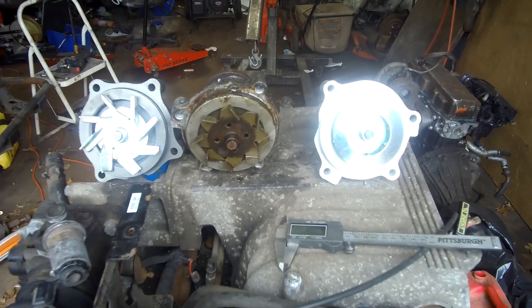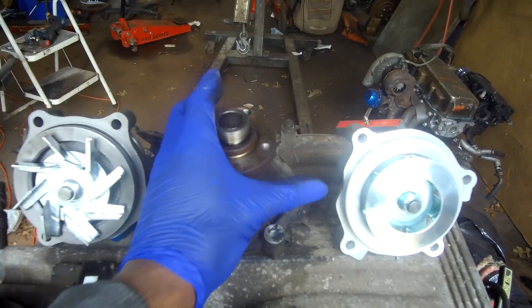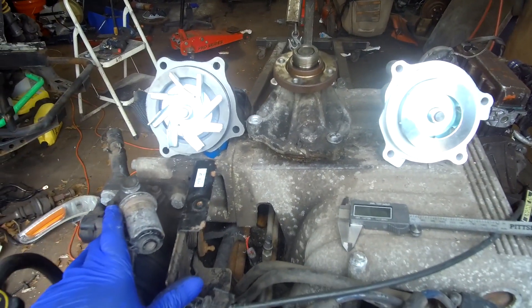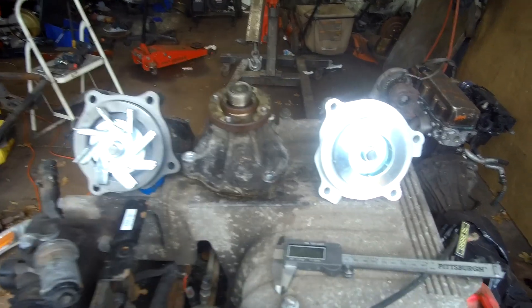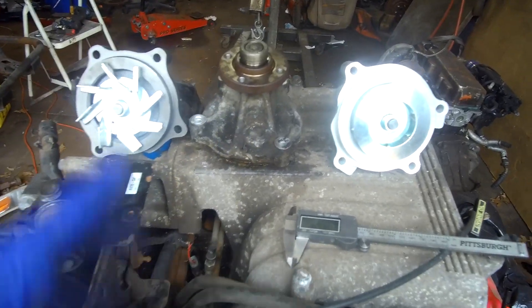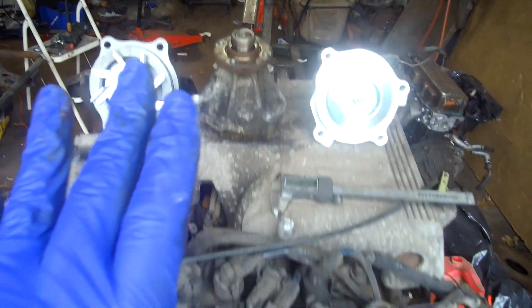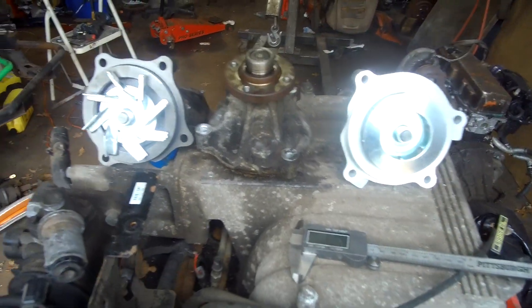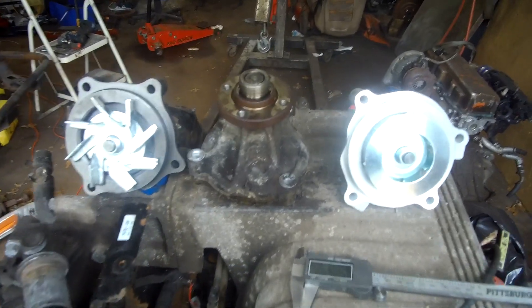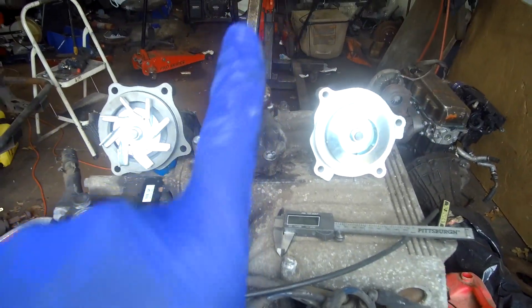I was thinking about getting rid of the fan situation on my car and running a regular electric fan to add a few ponies. But behind the scenes, if you're running the car really hard, a mechanical fan setup like this is better because you know it will not fail. It's fixed, mechanical - versus something wired up running on relays. If the relay gets hot, the relay won't function and the fan won't function. So it's best to have this old-school traditional setup.